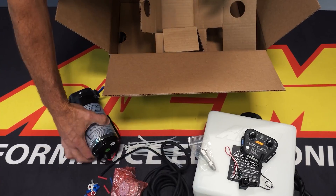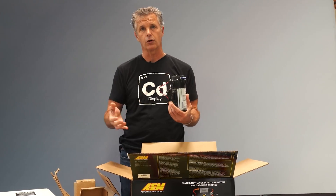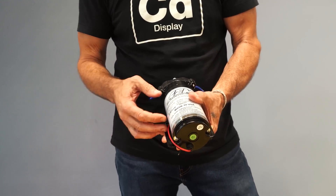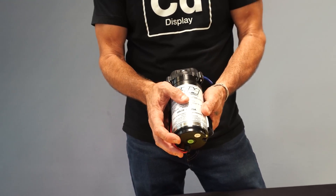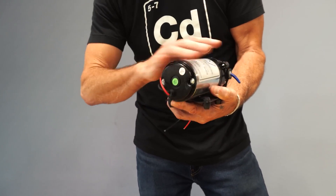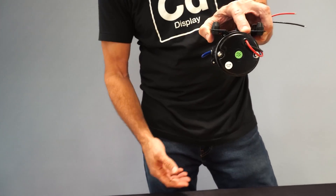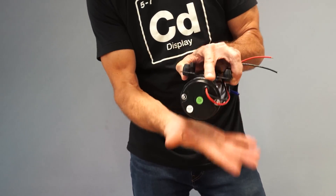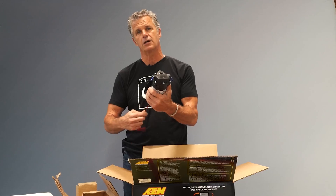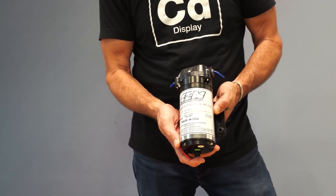The pump — historically we recommended mounting in a cabin away from environmental water, road debris, snow, rain. Now we've gone to a waterproof pump, so this can be mounted in the engine bay. Think of a pickup truck where the frame rail is an awesome place for positioning the pump — you have no concerns of water intrusion or corrosion. It's a really nice update. And all of these changes that we've made over the years — no price change, same price. So you're winning.